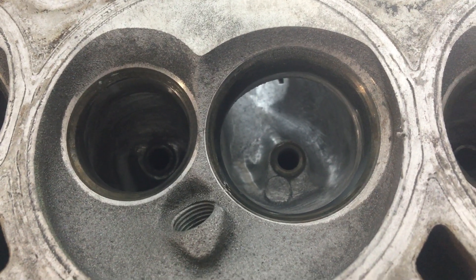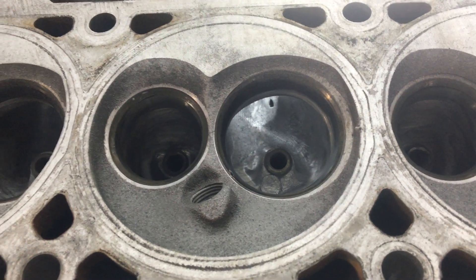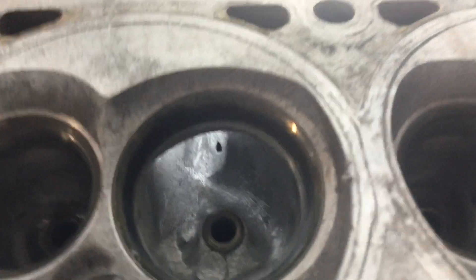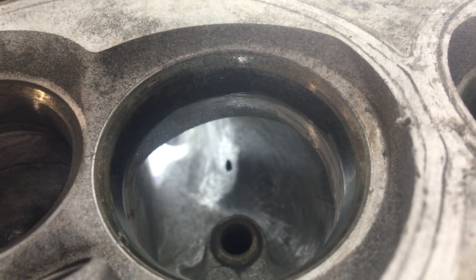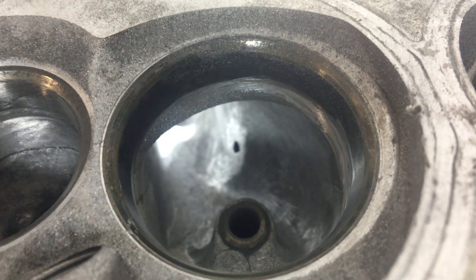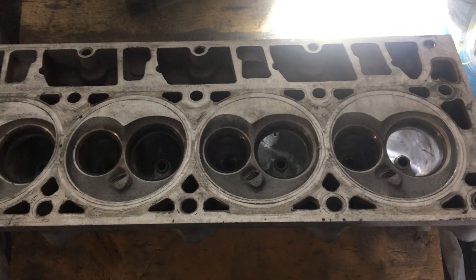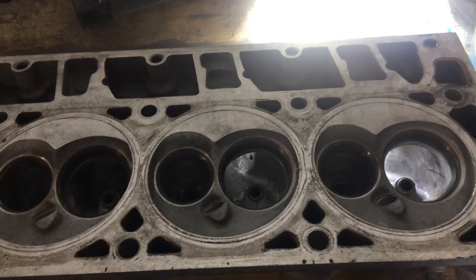We'd just run into the back of the seat. But that's just an update on the cylinder heads and what I'm gonna do — I might make another video and go over both parts once they're done. I just want to show you I hadn't done a whole lot of work to the intake, but it should increase flow enough. As long as I can get to the 270 to 280 CFM range at .600 lift, I should be able to achieve the 500 horsepower goal that I'm shooting for.